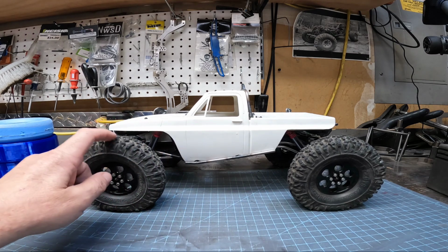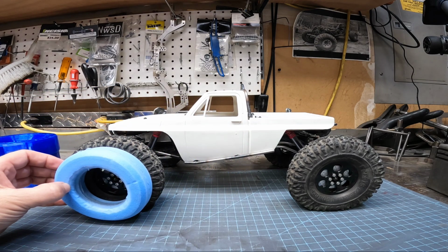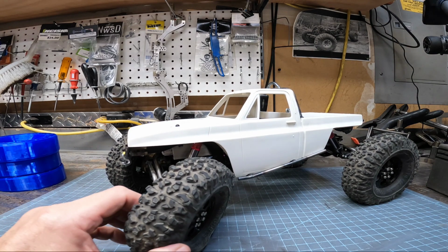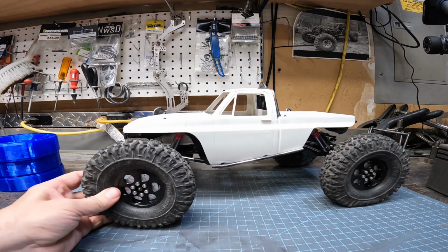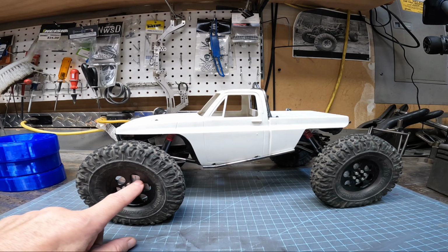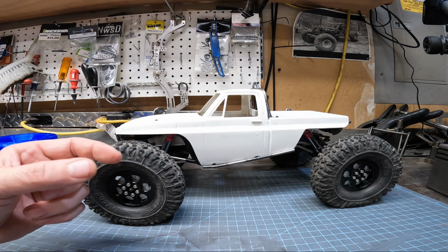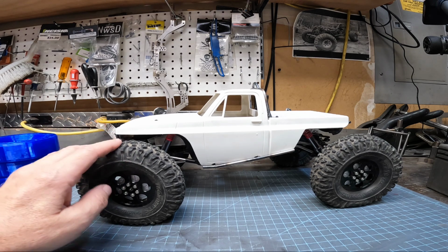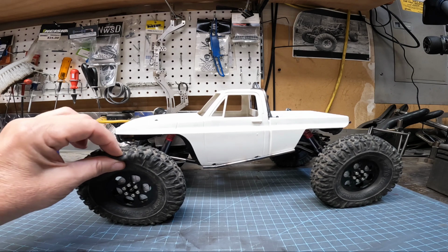I don't like the foams I have in it. The foams are in a pinch. They're single stage Pro Line foams that I stuffed in these custom cut and shut Landmines, 1.9 to 2.2. They're just as narrow as a regular 1.9, but about 5 1/4 tall. I have them on these super shafty Osprey V3s. These things are narrow, like 0.6 wide. The clamping inside is about 13 millimeters, and the inside bead to inside bead is just over 15 millimeters. I made these up and got them stuffed in there just for that event, and they're bad.